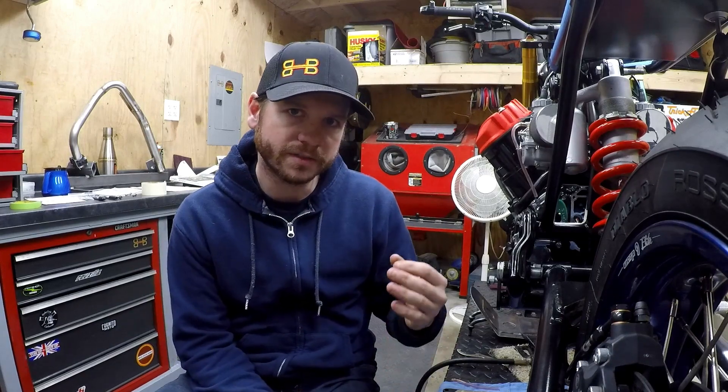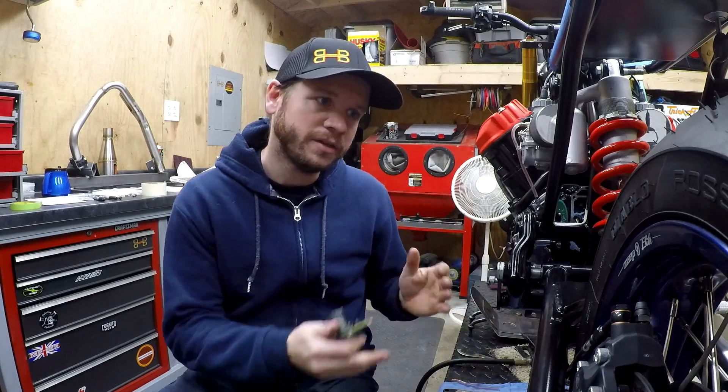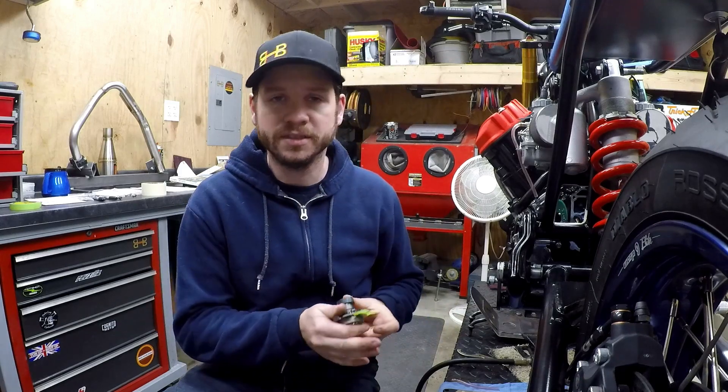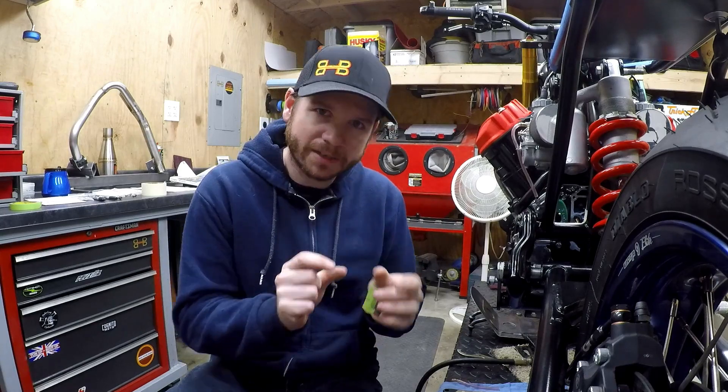This system is known as the hall effect, and what it's doing is getting rid of the transistorized stock ignition system for this particular bike. This is a GL650 engine, so being an '83 — say like '82 and later — you had a transistorized ignition system. You know if that's your bike because it has those two little boxes from Honda.